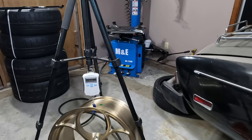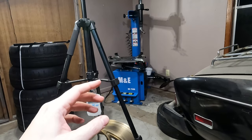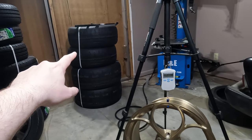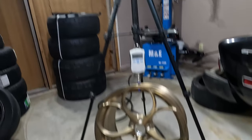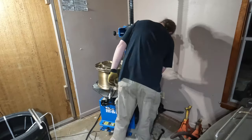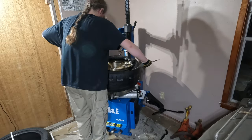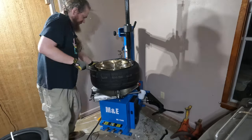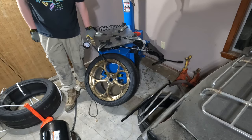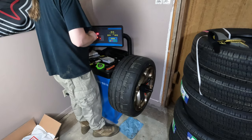You can see my tire machine in the background — I'm not very familiar with it yet, having really only done one tire, so I'm a little scared to put my brand new RE71R's on there. I did a time lapse with the intention of talking through the mounting process, but the only interesting thing that happened was one tire required the cheetah — I couldn't get the bead to seat without it. All the other tires seated just fine on the machine.